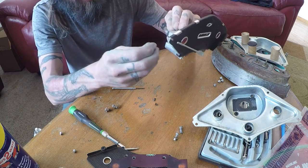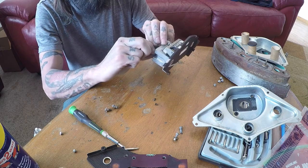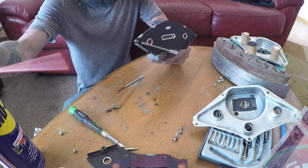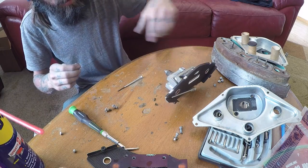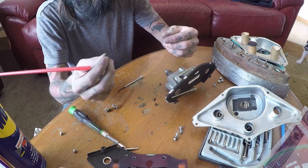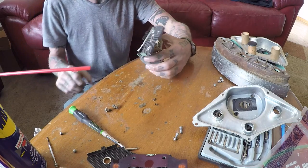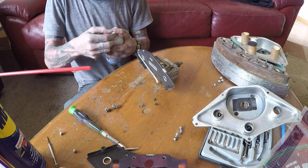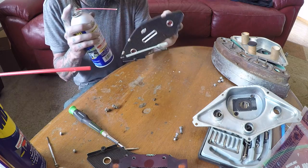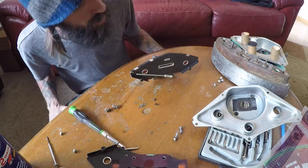There's a little brass plug on the side here with a hole, and apparently there is a felt washer — it is full of gunk. We're going to pull that out; it's like a little felt plug. You're supposed to fill that with a penetrant oil or water-removing oil. I'm going to use WD-40 and spray some on the felt so it doesn't soak up all the oil I just put in there. Then put the plug back in and seat it. Now I can put some lithium grease on the actual gears inside the mechanism, trying not to get it onto the magnetic cup itself. That'll end up hitting everything after a couple of rotations, so now we should be good to put everything back together.